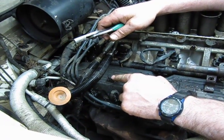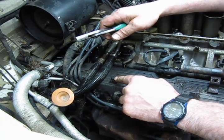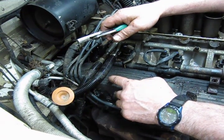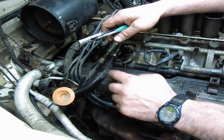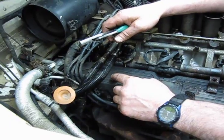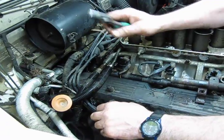We're going to drill that right out of there using, I believe, a 21/32 drill bit. That'll clean out the whole chamber. We blow it out with compressed air. We install the new one, and then just put a slight crimp to also lock that in place. But if you try to do it on the vehicle and you start breaking it up, pieces are going to fall down. It's much better to do off the vehicle.